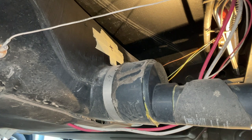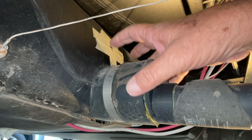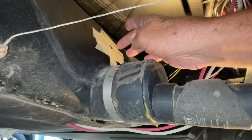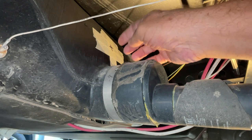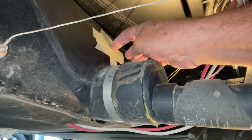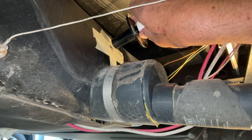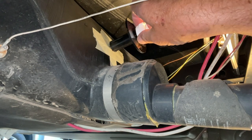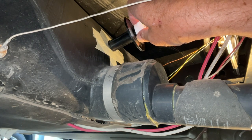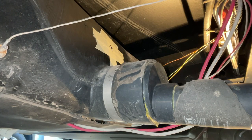I'm on the side of the tank here. The instructions say you can install this on any side of the tank, so I'm going to do it here near my exit port for draining the gray tank — that way the water blasts to the other end and flushes back, and the side sprays will also hit my sensors and keep them clean. The instructions say to measure down two inches from the top, centered with the drain pipe. I'm going to drill a one-inch hole right here. The tank is slightly sloped at an angle, so it'll spray slightly downward, which is fine — it'll splash all over and clean the tank.